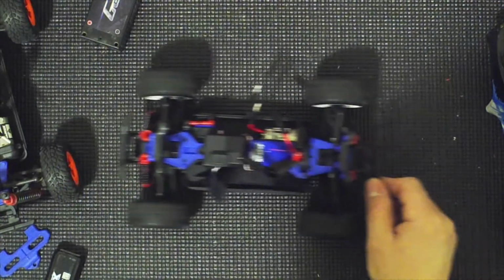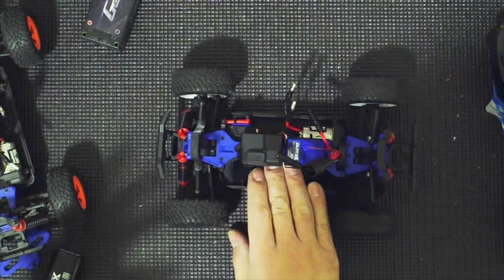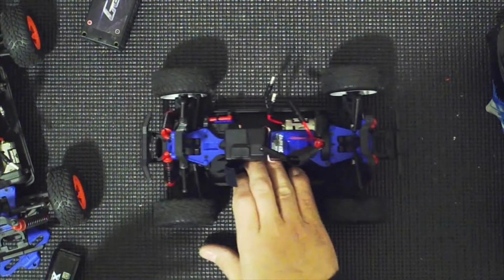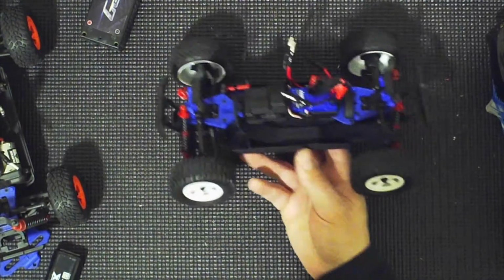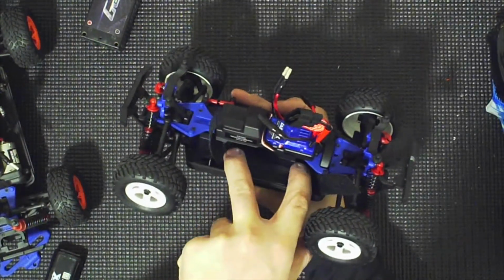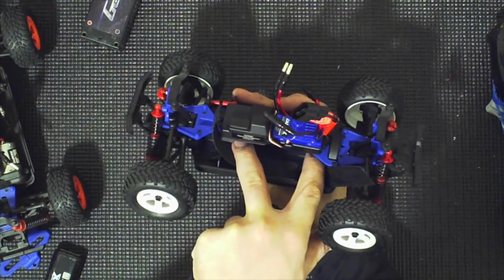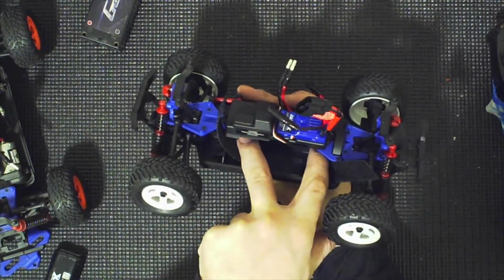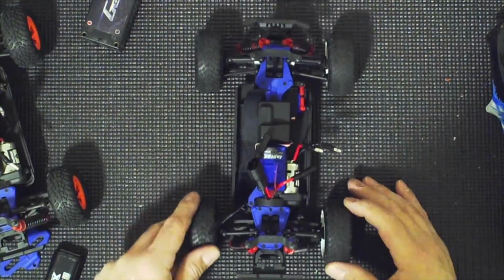that explains why right now it's fine. And before, I thought it wasn't meshing properly. It was probably just the battery hitting the shaft and creating resistance. So anyway, other than that, that's it. So what happened, based on the investigation here, the LiPo battery appears to have been contacting and creating friction between itself and the shaft, created more resistance, and fried the motor.